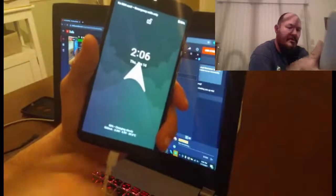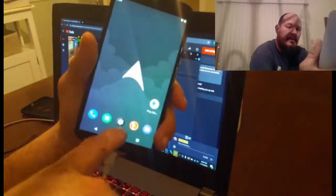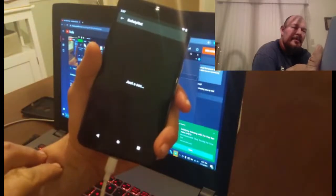So it's booting up. So that's good. It's booting, booting. We'll swipe to unlock, and then we'll go into the app drawer, click on Magisk again, and we will click on the settings first. We'll go in here and click on Magisk Hide because the new ones, that's how they work. They change some stuff around, and we've got to click OK for the Google API files. I'm sorry, API files. We've got to let them.